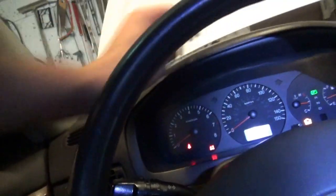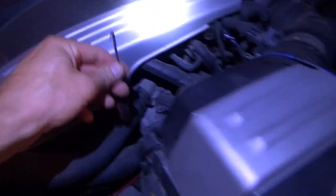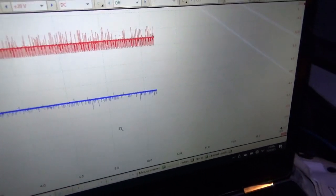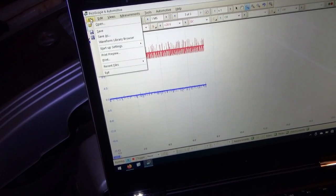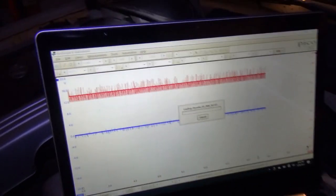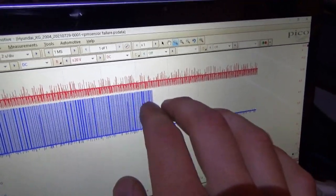The tach is actually not working at the moment and we don't see anything on the signal wire. I'm going to try tapping on the sensor and see if we can wake it up. Looks like it's dead. I think it's heat related — the car is warmed up now. Before turning the camera on, I actually captured the signal when it was still there, and here's what it looks like. I tapped it and it went away, and now it's just dead in the water.